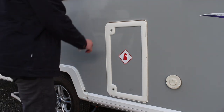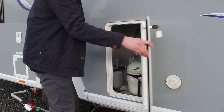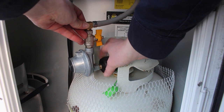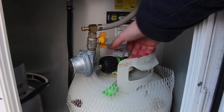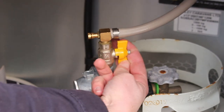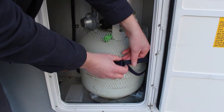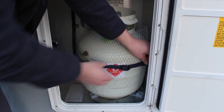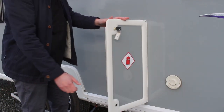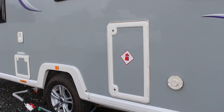Your caravan comes equipped with a gas bottle and the mechanism which feeds gas to the rest of the caravan. First, screw on the gas feed mechanism using the black connector. Once attached, the gas bottle can then be opened to start releasing gas. It's important to check that the yellow valve is open. The gas bottle must be turned off for travel and is held in place by a blue strap. Refilling can be done at many gas stations around the country, and there is a fee for returning your gas bottle under the limit. You may also use the swap-a-bottle program at participating gas stations.